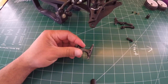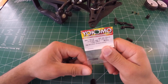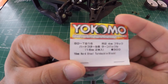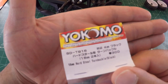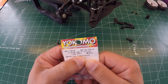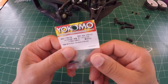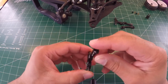Through the magic of YouTube — this is actually two days later. What you need are the Yokomo 16-millimeter hard steel turnbuckles, black. I've already assembled one of them because I forgot I was recording a video. Checking back my footage, this is where we left off last time. The finished product has the turnbuckle going in there, and then you attach your knuckle which goes here — you just have to take the knuckle off the old arm, that's all.